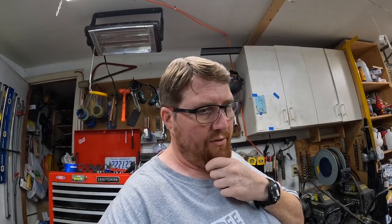I got no confidence in this thing right now, simply because I've never put an engine together, so I've never been at this point. But once it starts, I'll probably build some confidence. We're going to go ahead into the Holley and just switch it over to 42 pound injectors and a 347 displacement.